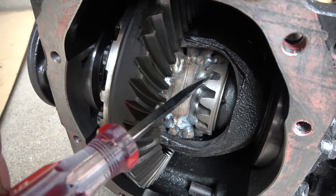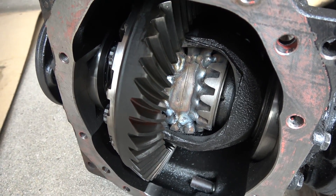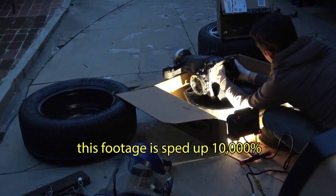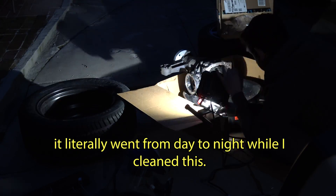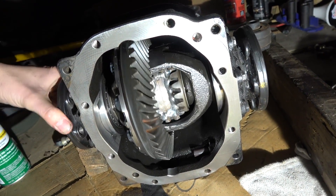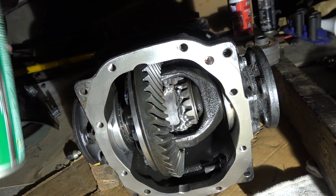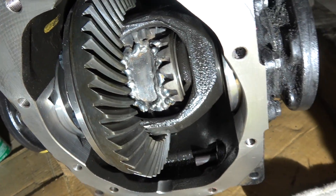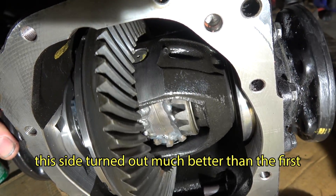I'm going to go through and clear up all these little nodules and slag, then spray it down with brake cleaner again, and then I can fill it up with gear lube. This thing is turning completely smoothly now — there's no grinding, no scraping, no clunking. It's just working completely as it should, minus the fact that it's now welded completely shut. I put another can of brake cleaner through this thing. I'm pretty happy with how it turned out — I've seen much worse diffs with much worse welding hold up to a lot of abuse, so it should be good.